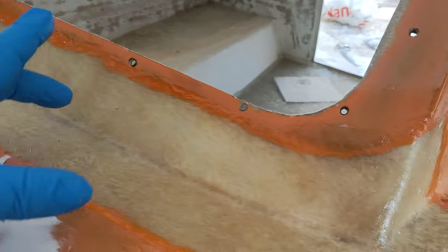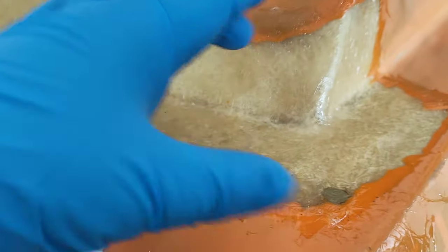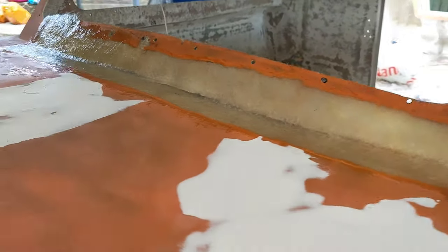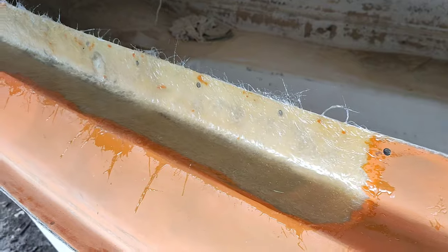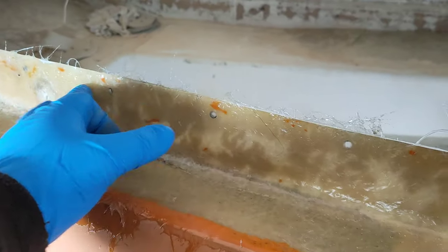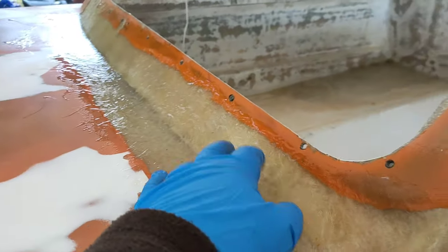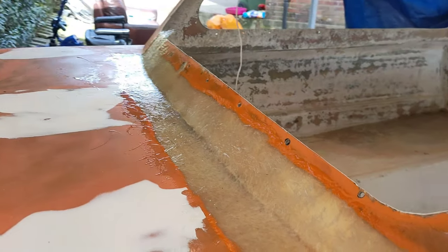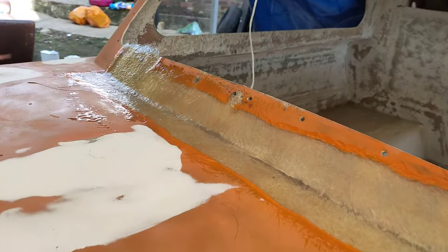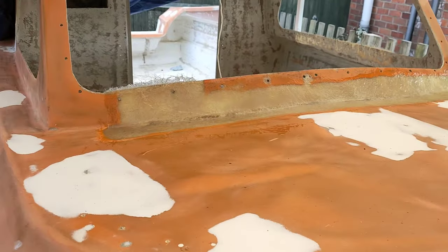And it's still wet, but it's going off. Bit more heat, the old heat gun. And it should be solid. Okay, so tiny, tiny bit tacky, but it's nice and hard now. It's gone off. That winter grade stuff works quite well, especially where it's cold. Pump the heat gun in. I could go another 10 minutes or so and it'd probably be rock hard, but there's no need. So